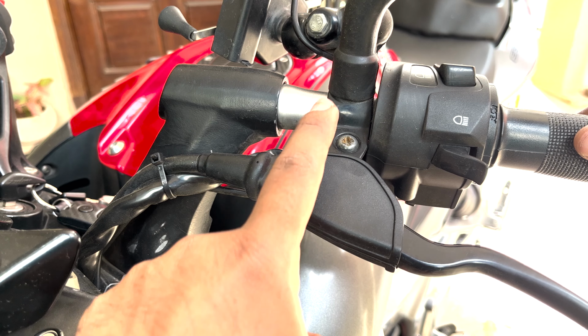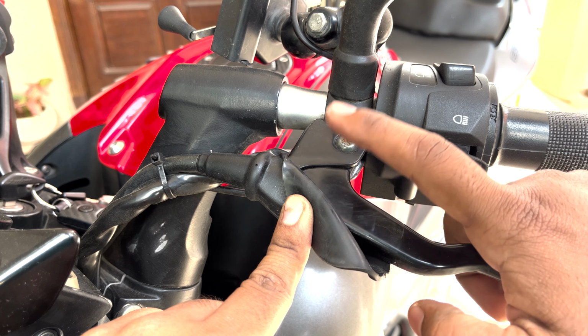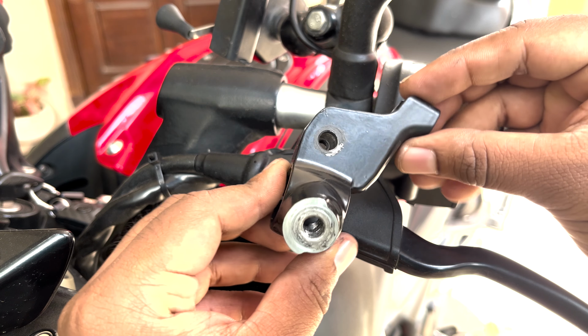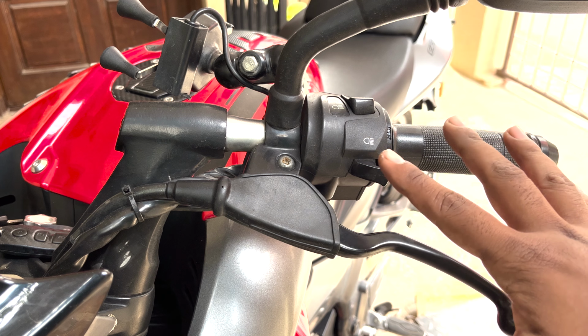Now the same way, the left side also doesn't go a direct fit, so you need to replace this entire clutch yoke with the Dominar 400 one. And this is how it looks like. I'll leave the part number for this yoke too in the description below of this video. Now the replacing the right side mirror was pretty easy.